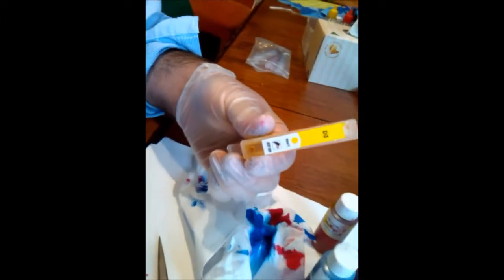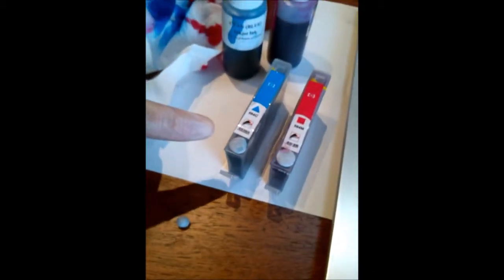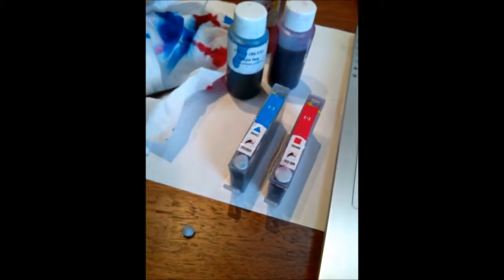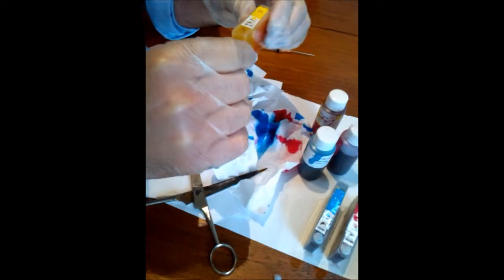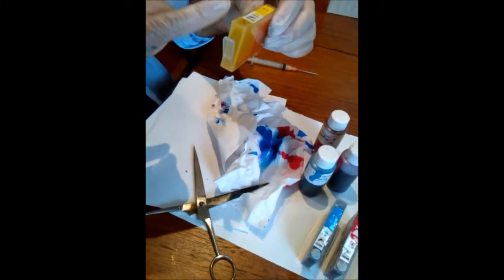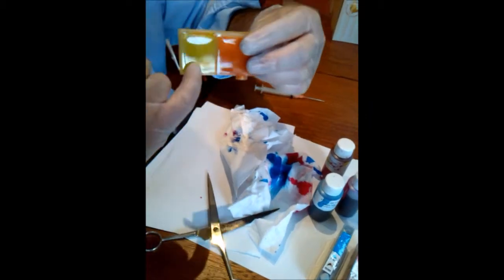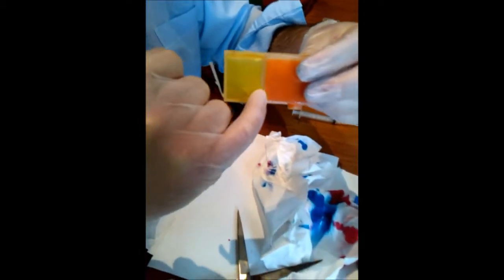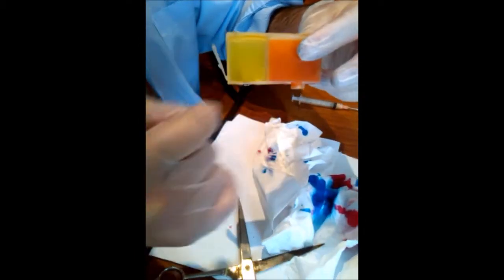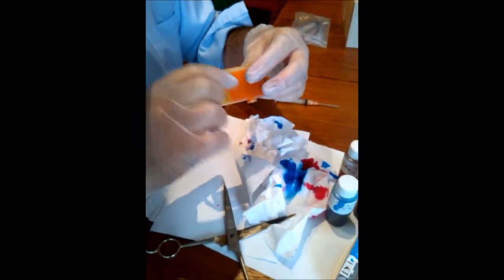So that's made a hole now — it's quite small. You can see on these ones that I've already done, I fixed up the hole afterwards with blue tack over the top. So at the moment now the pressure has been released from inside, and the ink has all flowed into the sponge container, which is good — we want ink to come out of there eventually.